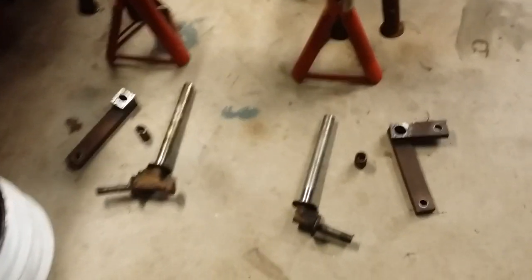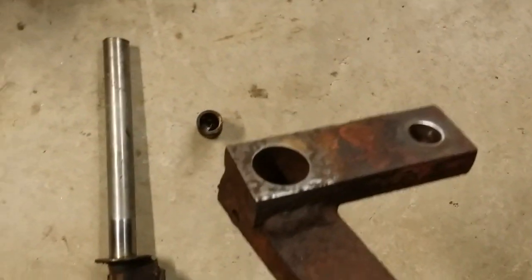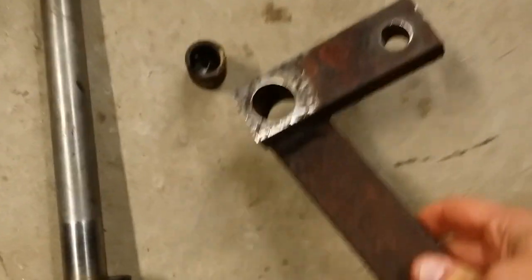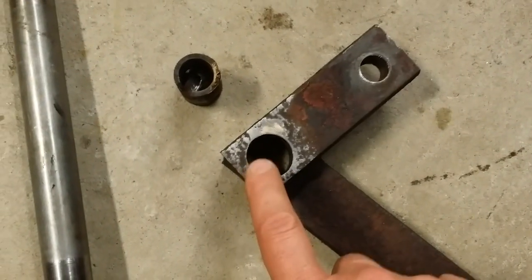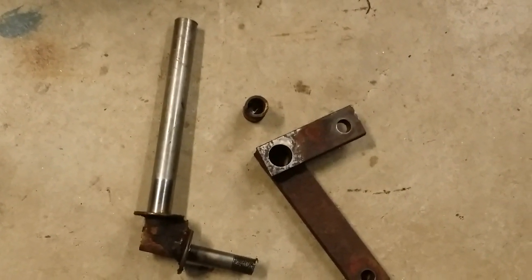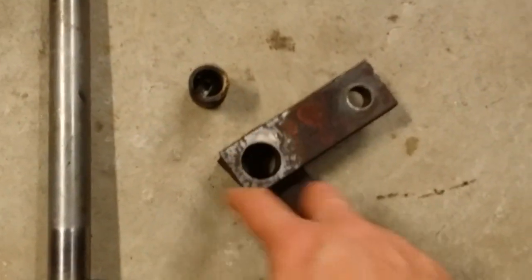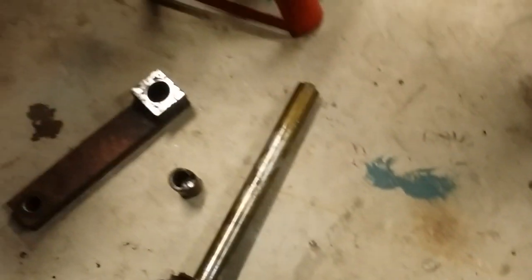After a little cutting and hammering, I was able to get the one inch bar stock out of the second knuckle and in this case I didn't even touch the inside of it, which was awesome. You can see there's a little bit of a gold color - somebody must have tried to braze weld this to the top of the spindle, but it was unsuccessful. There was no way to get brass to flow down there without flux, so it was just a blob of brass. I had to take my cutoff wheel and clean them up, deburring everything and cleaning that area up.